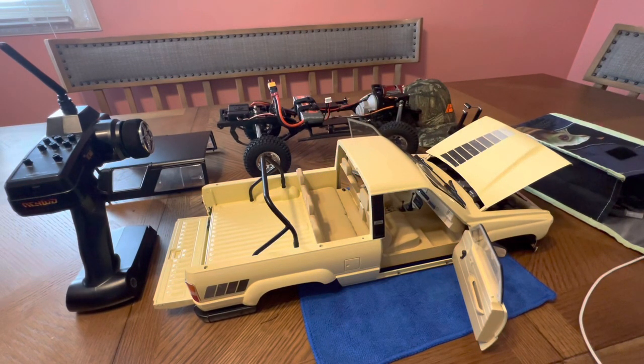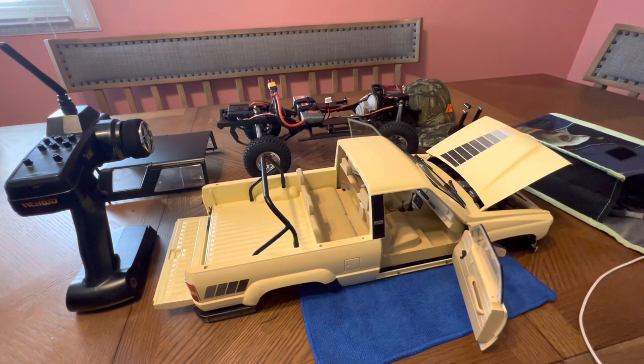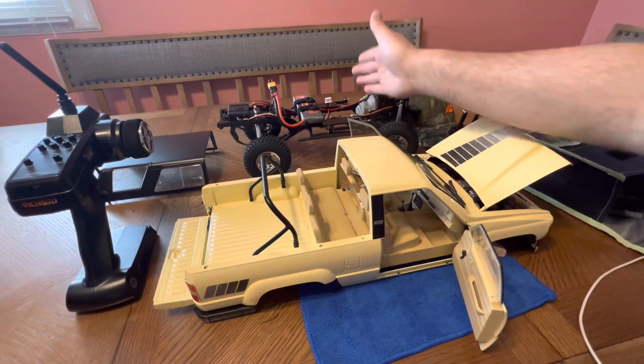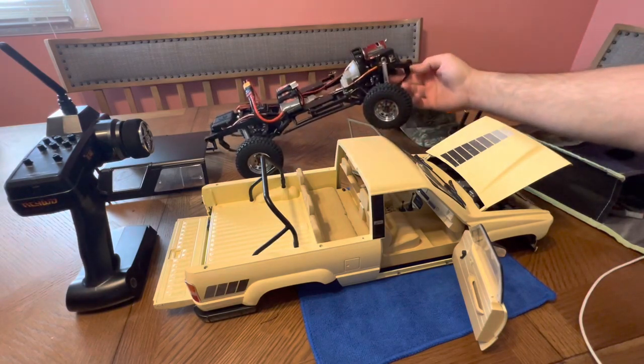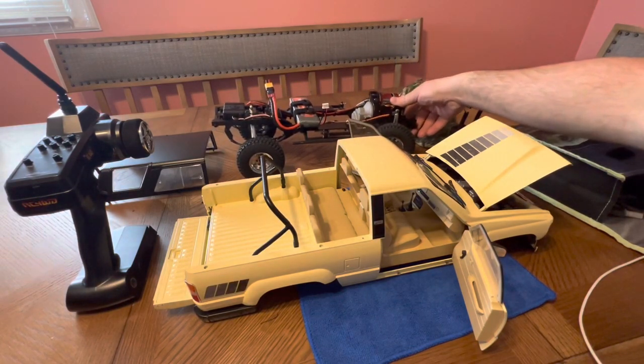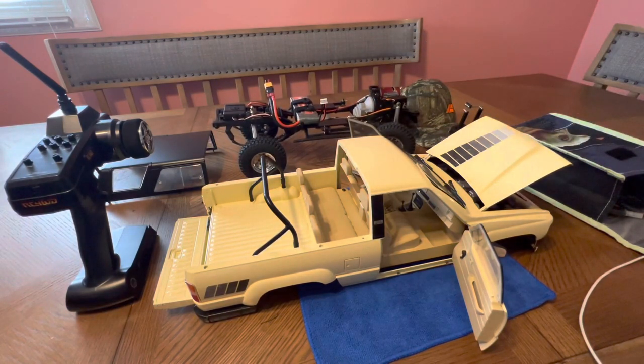I noticed after rock crawling, my front wheel was loose up here. As far as everything else was, it wasn't. I did Loctite all the way up to here. Everything on this backside that goes into metal, I did Loctite. I didn't do the front end because I call it the shackle mod. These little shackles right here, instead of it flexing to the front, I want it to flex to the back so it doesn't push away from the rock. It just really helps out a lot.